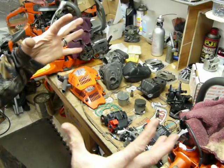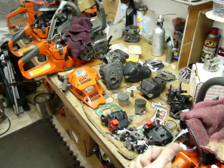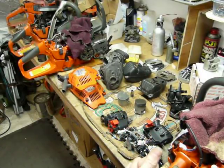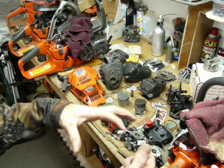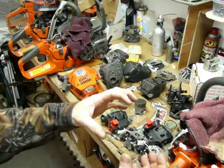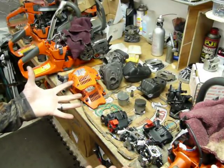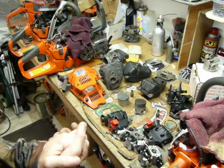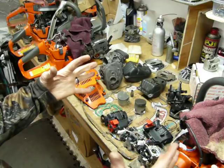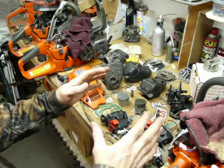Think about the concept. You take the body of a torch, you stab the throttle on the back, which is basically the air circuit, adds a bunch of oxygen, oxyacetylene torch. That's how you get your cutting effect. If you want like magnum heat, we have the same kind of a concept going on with these saws. All the stratification style engine designs, you're actually dealing with a controlled air leak, if you will. We're actually having raw air come into the circuit.